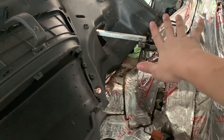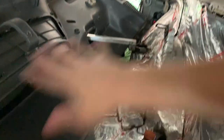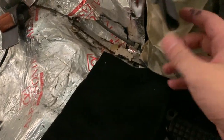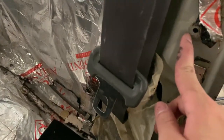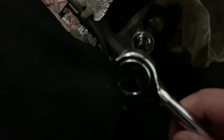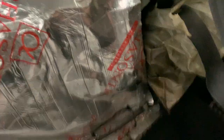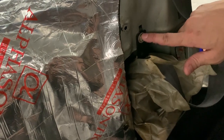Many many hours later, I am finally done. It took way longer than expected because I had to remove the strut bar and all that. The main thing we want to tackle today is this — the seatbelt assembly. There's this little plastic baggy thing, I have no idea what it's for, maybe it's to protect the thing from dust. It's just two plastic clips — they just pop out using a pry tool and this plastic should slide right off. To remove the seatbelt, just lift it up — there's a screw right here. I think this is a 19mm, so it's quite big. And then I think there's a 10mm on top. One big screw at the bottom, one small one on top and the thing should be out.